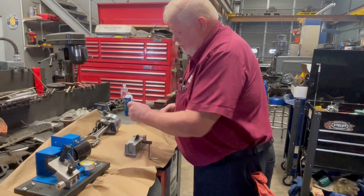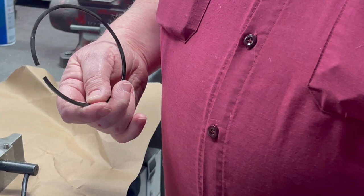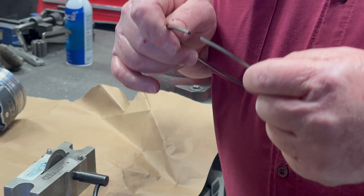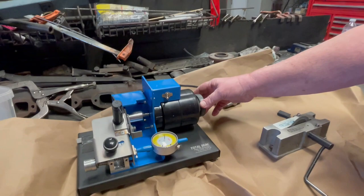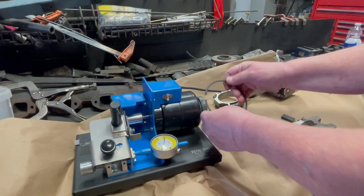When you are done, the side you're grinding on is going to leave a sharp edge. You want to knock that off — what works good is a stone; you can just knock the little sharp edges off. If you don't, you stand a chance of it scratching the cylinder when it goes in. This machine here has a wheel on the end where you can quickly buff it. It's very, very fine — almost like rubber — and that'll take the edge off it.